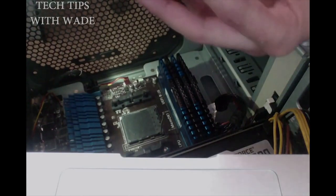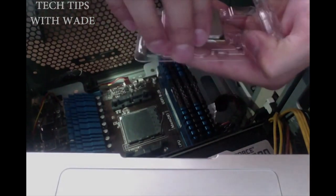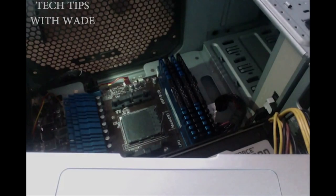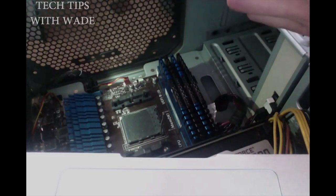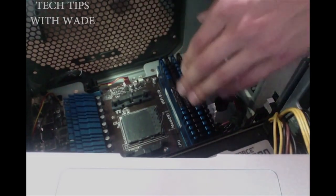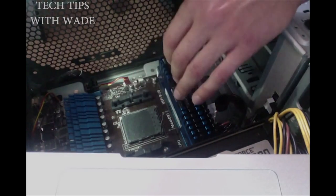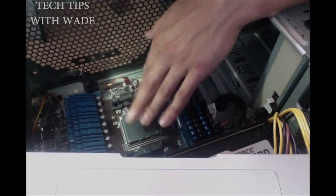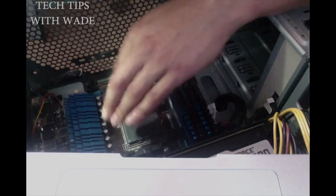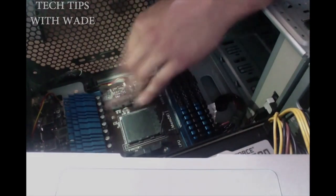All right, everybody, now we're going to install the new processor. So we're going to go ahead and take your processor box, unbox it. Another thing I forgot to mention in the beginning, which is consistent with computer tech installation of a CPU: after you turn on your PC, before you take off the residue, you can leave your PC on for 5 to 10 minutes, let it heat up the previous processor you had installed, so it heats up the heat sink and the thermal paste. So basically your thermal paste will be nice and ready to go, so you can rub it off whenever you uninstall.